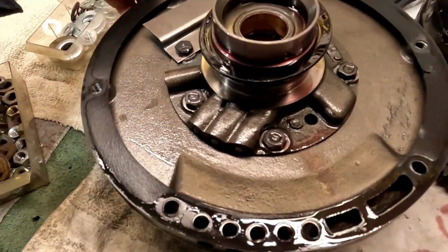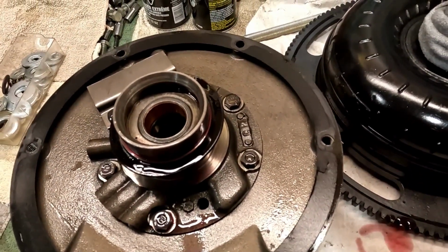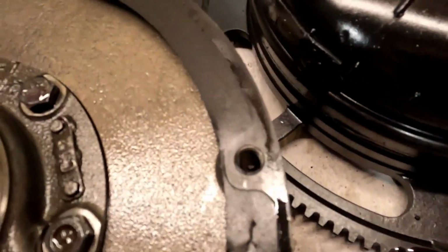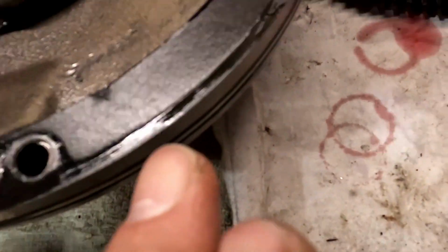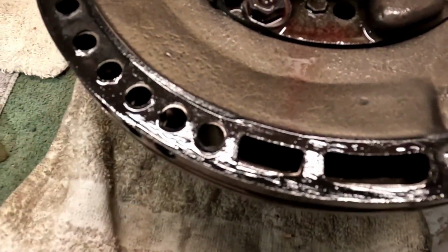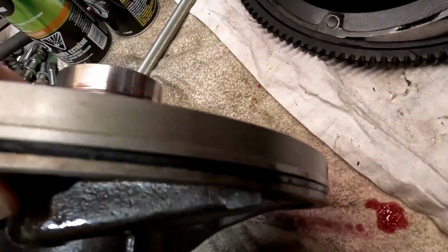So if you remember, we did have a little bit of residual fluid resting on some of these bolts. This is the back side of the pump. You do see a little dampness on this gasket on the outside. So it is possible that fluid was getting past that, and definitely soggy here at the bottom. We're definitely going to go ahead and replace this paper gasket. See if we can identify any issue on the rubber seal here.